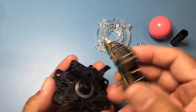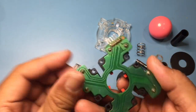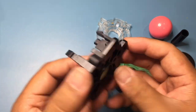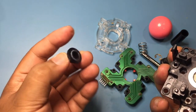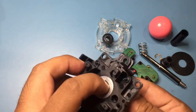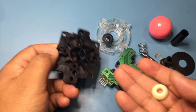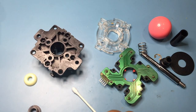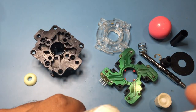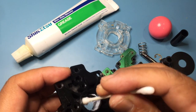With the gate off, the microswitch PCB can be removed. The body and pivot joint also need to be cleaned up along with the lubricant. Once the parts are cleaned, use Shinetsu silicone grease, recommended by Sanwa, to re-grease these parts. Try not to use any other lubricant as they may be harmful to plastics — you can find that tool cheaply on eBay.